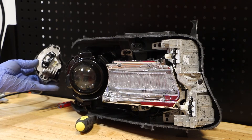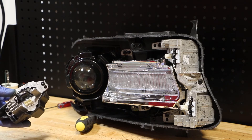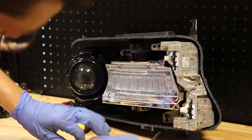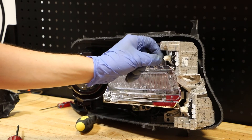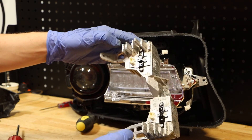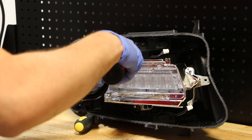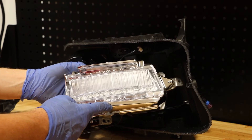There was an LED here on the outside corner but the housing was pretty busted, so this just fell off when I took the lens off. I'm going to go ahead and start by removing the three LED units. This outside one is actually one LED unit and there are two wire connectors on it. All I had to do was remove the three T20 screws and the two wire connectors and this big outside LED unit came out. The turn signal LED unit is held on by two T20 screws and there's a single wire connector on the bottom of the turn signal unit.